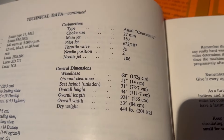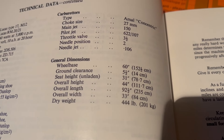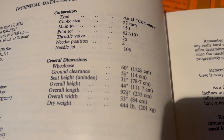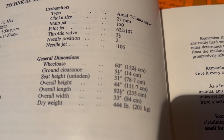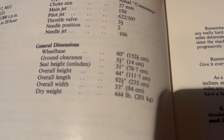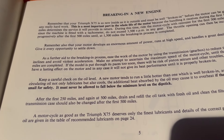The other thing to check is that the pilot jet isn't blocked. I've already done a blow test on it and it seems fine, but there's also a test I can do by pushing some petrol through it. We'll do that, rebuild this carb, then check the other two and reassemble them. Then I think what we'll do is swap out the new carbs on the rack for the original carbs, balance up the slides on the rack visually, and set the air screws — pilot screws — out around one turn, maybe just over. Actually, let me check through this book as it might give an indication about where to begin with the pilot screw setting.